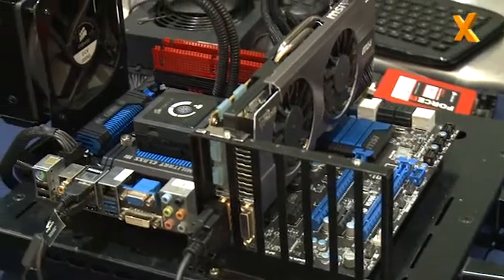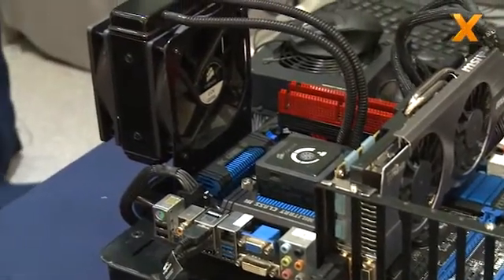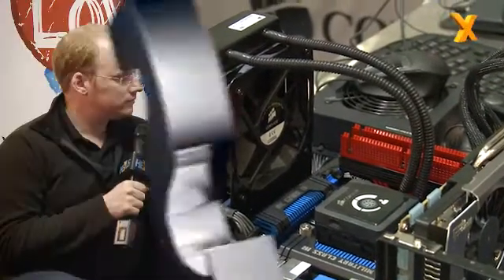Which is consuming less power, so it's pretty good so far. But what are you using for cooling? On that one I've just used the H80, which is the smaller Corsair — it's a single radiator water cooling system — in a hot environment down there. I've yet to really push the system. I don't want to break the equipment before I come and do the demonstration, so I've been relatively mild, but we're seeing here, fully stress loaded, Prime 95, 5 gigahertz, temperatures 67°C, consuming less energy than the Sandy Bridge system — looking very, very good.